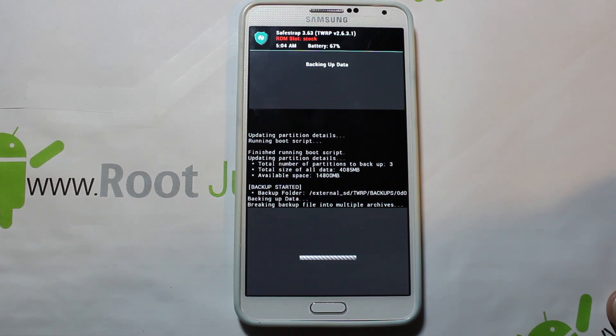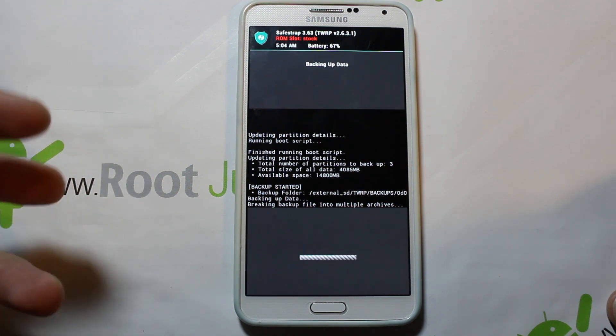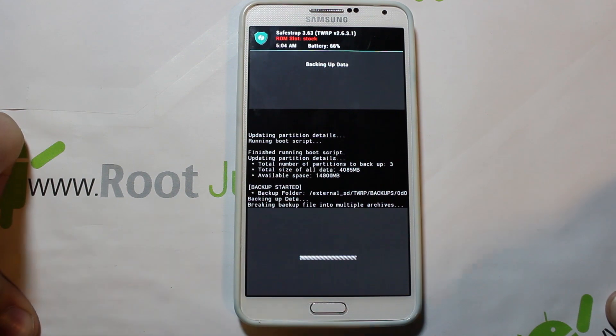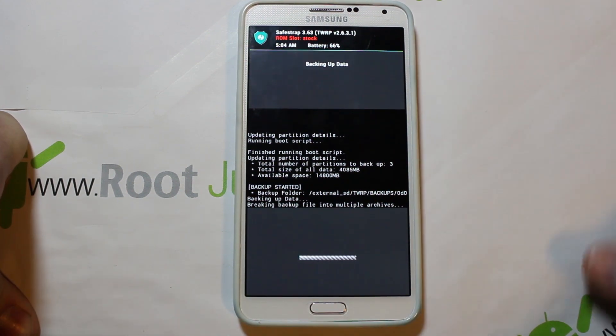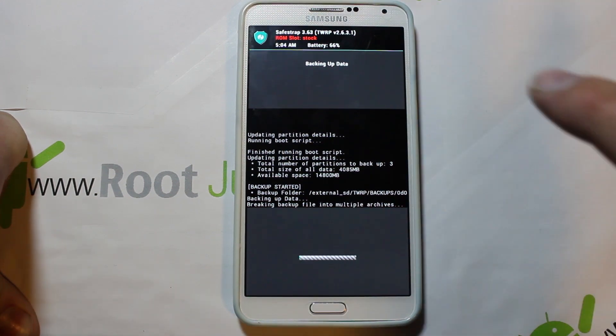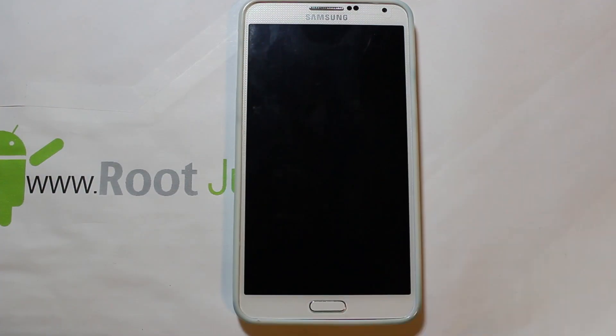What I'm going to do is make a backup of stock and then install it to a ROM slot. That way if you boot up that ROM slot, it doesn't matter what happens — you can totally goof it up and then just boot back to your stock slot and you'll be back in business. So if you want to do themes or edits or whatever, you're good to go. I'll let this run and explain more as we go through the process.